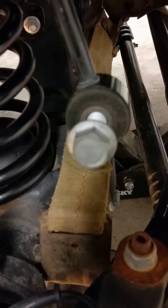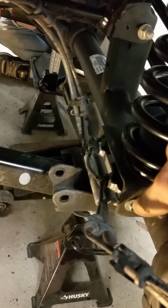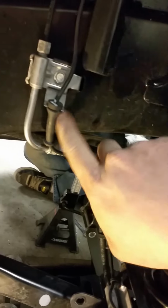And you're going to torque it down. We'll go through everything at the end with the torque specs and torque wrench, but just make it snug for now. But that's it. And I'll take the ratchet strap off, and now you're going to connect your sway bar, which is pretty simple. If you kept the bolts right there, we'll put that in. Alright, so we got the sway bar connected. Everything's all back, snug down. We'll do the torques at the end. Just make sure everything's good. I put my brake line bracket back, reconnected all the way up there.